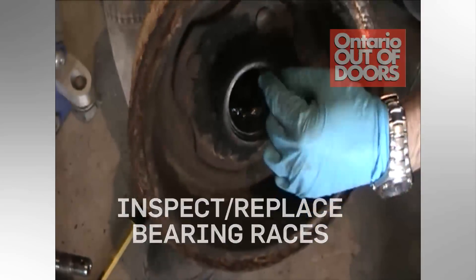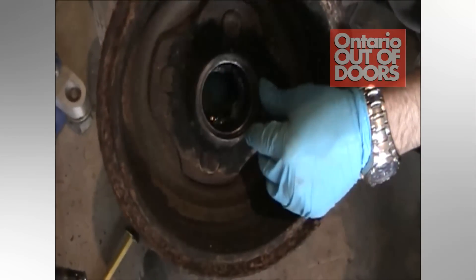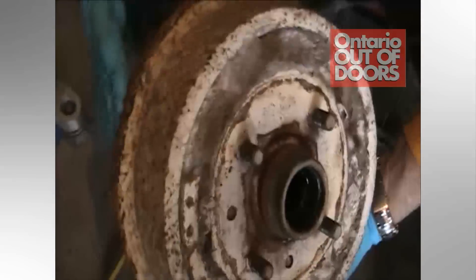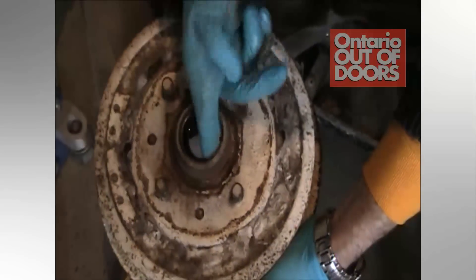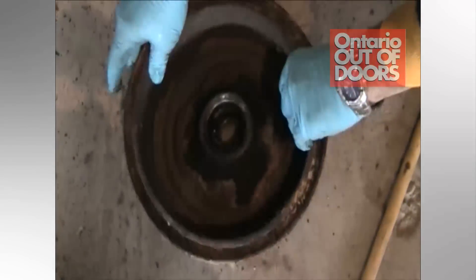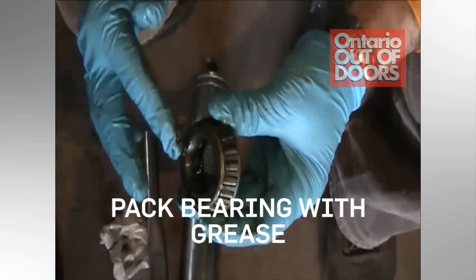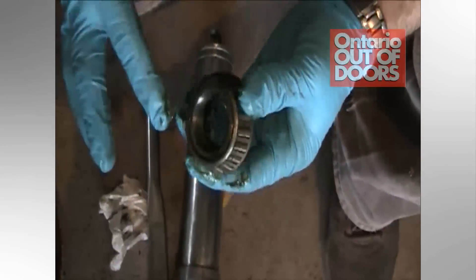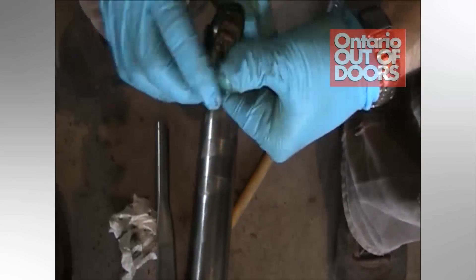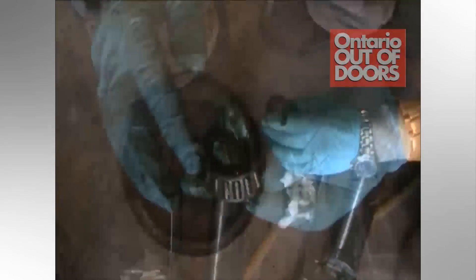What the manufacturers suggest is that if you need to replace your bearing for any reason, replace the race as well. It just pops out from the opposite side. There are two races — one for each bearing assembly — and they are different sizes, so don't mix up your front and rear bearing assemblies. When bearings come new in the box, they're coated with a thin film of oil to keep them from corroding in the package. So you'll want to pack the bearings with grease — take a liberal amount, fill all the voids and crevices, roll it around on the rollers and get it in there nice and full before you put it back into the hub.